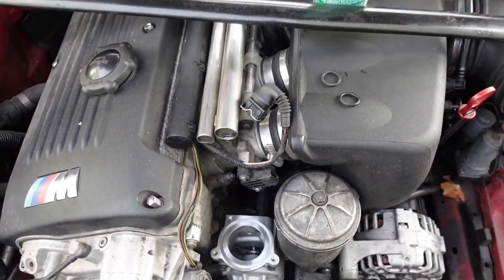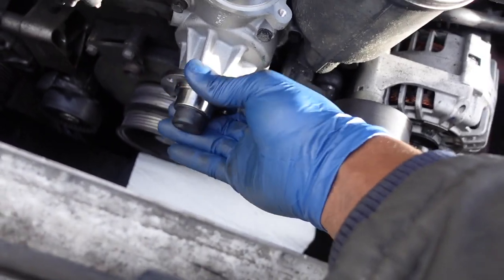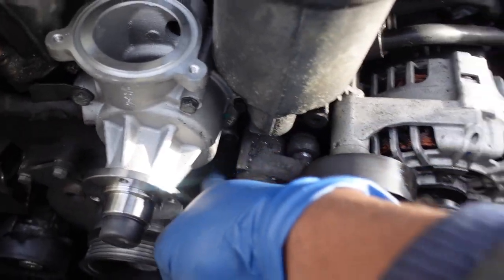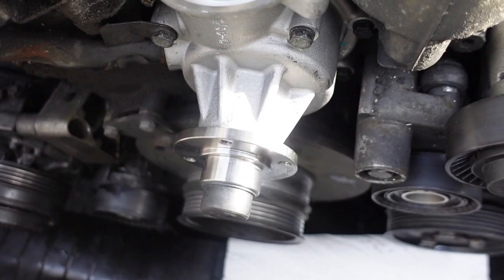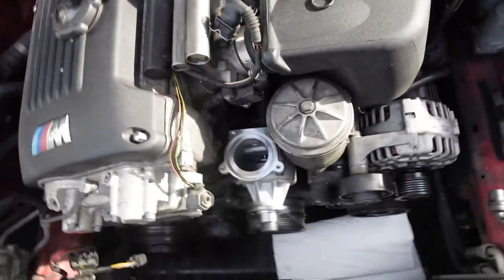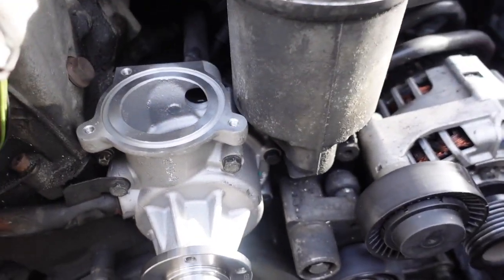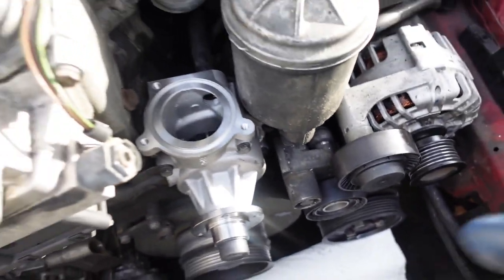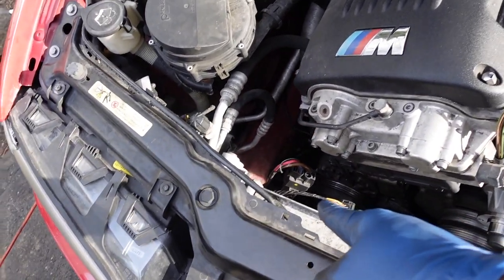Okay, so the camera died, but what you want to do is torque these bolts here, all five of these 10 millimeter bolts that go into this water pump. You want to torque them all down to, I believe it's 7 foot-pounds. Yeah, so 7 foot-pounds. No more than 7 foot-pounds. They don't need a lot of torque. So you want to do that, and then we can start assembling the thermostat,